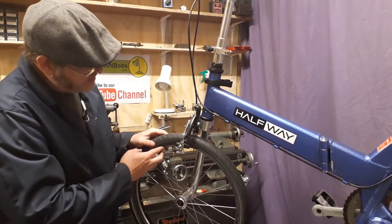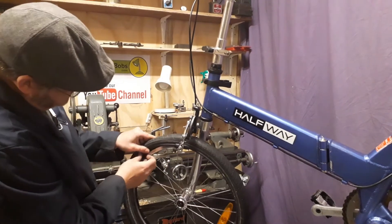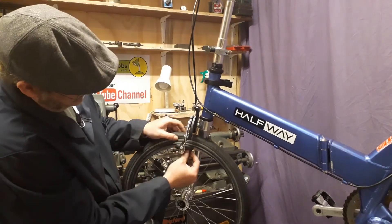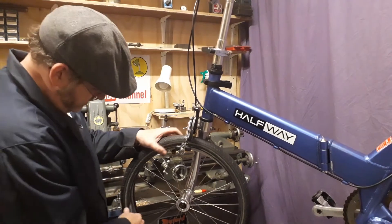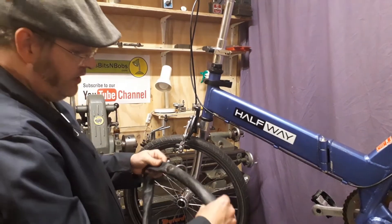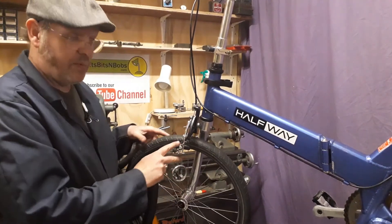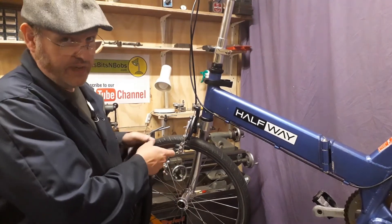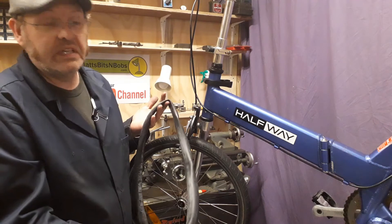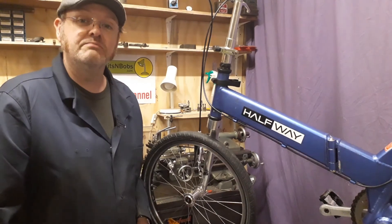As I said, we can take the inner tube out of the tire without even removing the wheel. You just pop the tire off the rim and you've got plenty of access — you can reach in and get the inner tube to pull it out. You have just enough clearance past your brake pad to remove the inner tube from the tire, ready to do your repair. As you can see, this has already been previously repaired. To put a new inner tube in, just reverse the process. That's all without removing the brakes or the wheel from the bike. Brilliant invention, the mono blade — it just gives you easy access if you get a puncture while you're out and about in town. All you need is a patch, a couple of tyre levers, some glue, and away you go. Thanks for watching — give the channel a like and a subscribe, and until next time YouTubers, it'll be right.